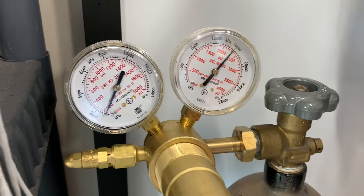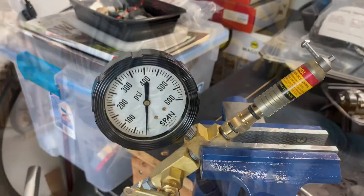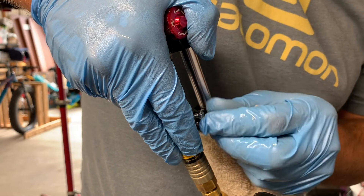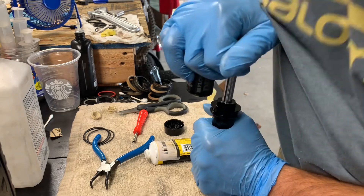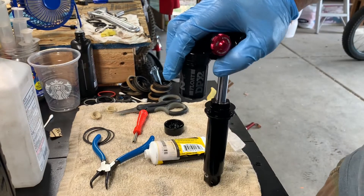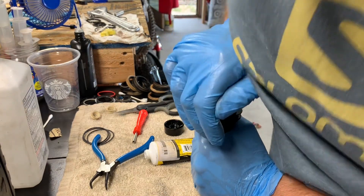After meeting all the torque specs, oil specs, and getting all the air out of your system, it's time to do the nitrogen fill. This step will be harder if you don't have the nitrogen tank, safety needle, and all that stuff. The technique is learned, so you might just have to have a shop do this to make sure it's done right with proper continuity. I'm hand-dyno-ing this shock and you can see it's rebounding and it's also quiet — it's important to remember that the shock needs to sound like it's been rebuilt.